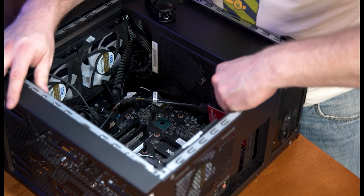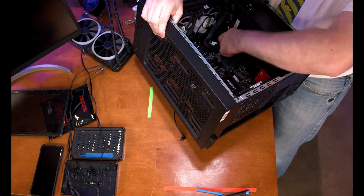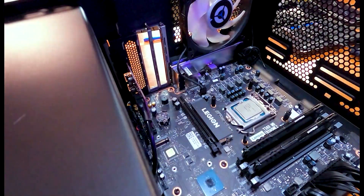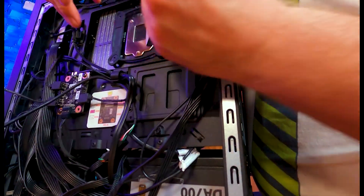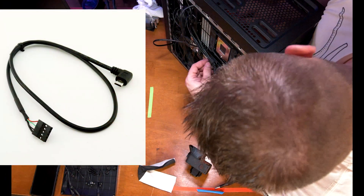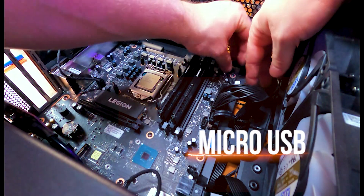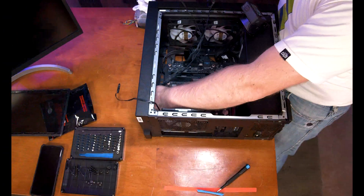Now we're going to install the 1x USB card adapter, line it up and get it in the socket, screw it down, and feed your wire to the closest hole so it's not running through the case. It also gives you two USB 3.0 ports in the rear, which is a nice bonus. This card adds USB headers and gives you control of the NZXT, which normally wouldn't be controllable without a USB 2.0 header. There is another USB 2.0 header on the board, but it's utilized by the Legion RGB controller — if you try to steal it, it breaks the RGB for the rest of the Legion. I'm also feeding that USB wire back towards the top where the water pump heatsink will be installed, wrapping it up so it's not in the way when we install the radiator.